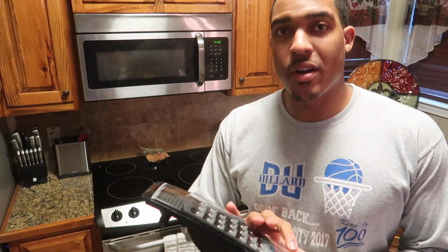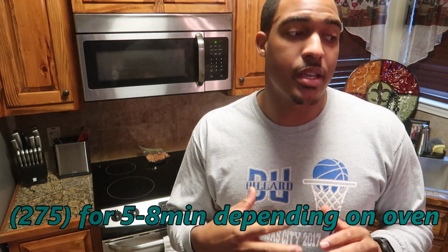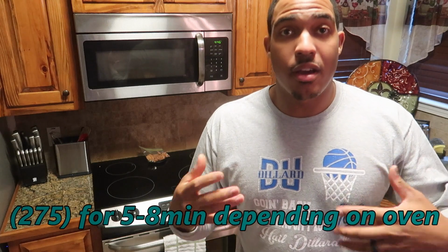But you don't want to get it too hot, because you'll start warping or bending your lens, and it won't seal back correctly when you go to put them back together. So about 5 to 8 minutes seems to be a pretty good time for me. And generally they all come apart on the first try. So that's what I'm gonna do.